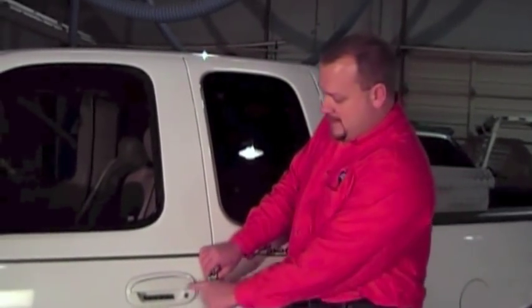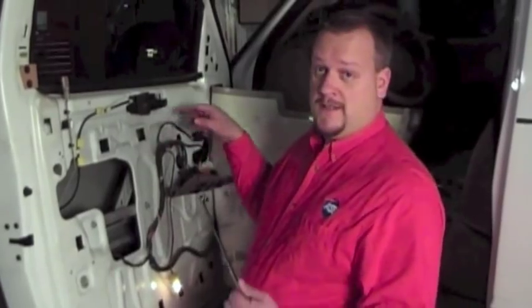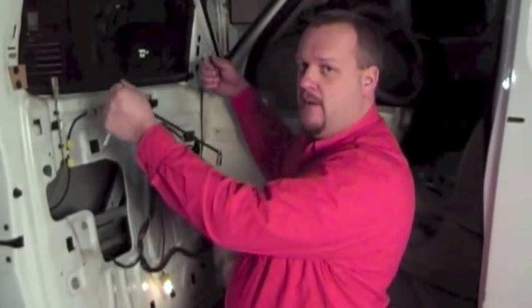At first glance you may notice these look a little different. That's simply because this lock cylinder is recessed inside the door handle. We're going to have to remove the door panel inside of the truck, then access the door handle assembly, remove it, and then we'll go to the bench and swap out the lock cylinders. As you can see, we've already removed the door panel — not a tough job, just really two screws holding this in. The whole assembly slides up and out.